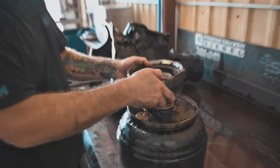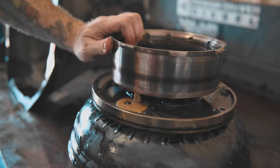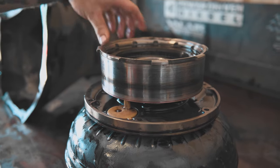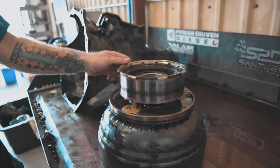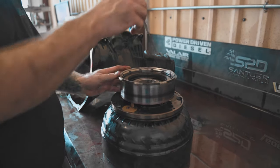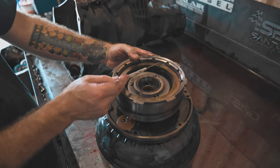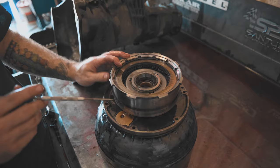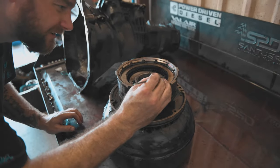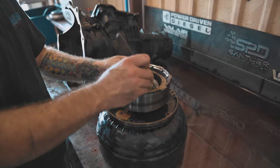Alright, so we'll move on to third gear. Obviously you can tell we got some burning from our band - whether it was loose or tight or just never adjusted, leaked, low line pressure, slipped it with horsepower, whatever. Third gear or second gear had some slippage. So third gear is on the inside - it's your direct drum. It's a 48 drum so it's naturally taller. The 47 drums are a little bit lower. So I think that means it's automatically a five clutch. Yeah, we got five frictions in there from the factory, so that's nice. That's plenty of meat for us to work with.